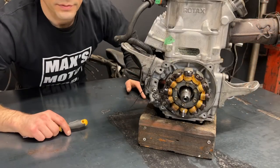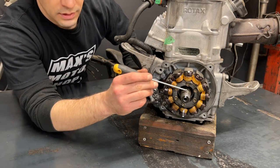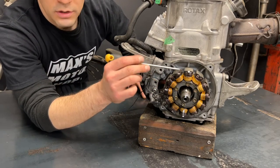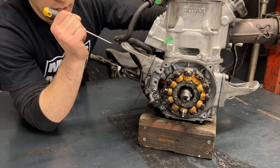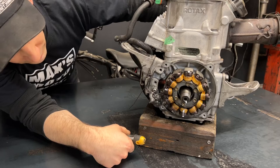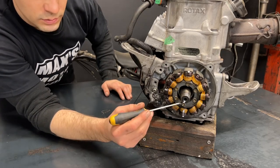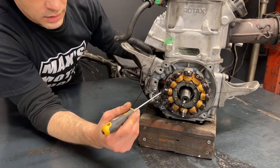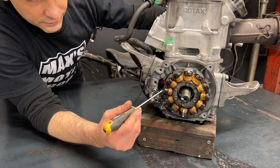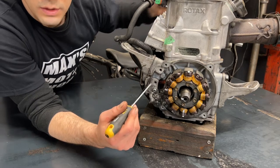Here's a better view of what's going on on the end of the crankshaft. As you can see, the flywheel key is pointing straight up at the 12 o'clock position when the mag side is at top dead center. Then spin your motor around and if your motor is timed properly, the flywheel key will be pointing straight down to the 6 o'clock position. On this motor, it keeps going and the flywheel key lines up just past nine o'clock when the PTO is at top dead center.